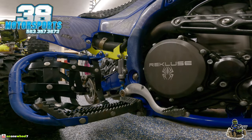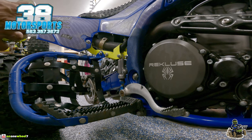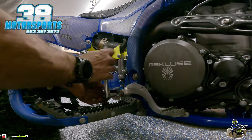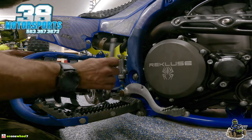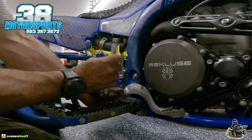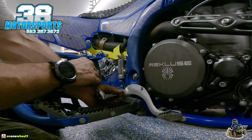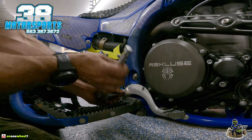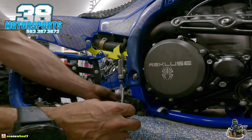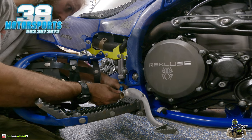We're going to remove the brake lever altogether — it'll make this install a lot easier. This is a 6 millimeter allen to get your bolt out. Then you'll need to remove the little cotter pin and the pin that goes through the brake clevis. Make sure you don't lose your spring, because the spring will fall off once you take this out. Don't lose your washer either — you need that. Let me get the spring out first.